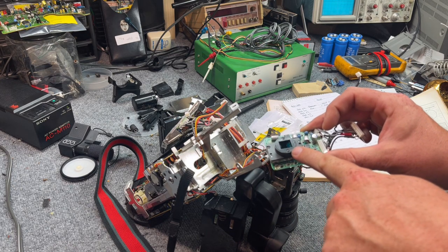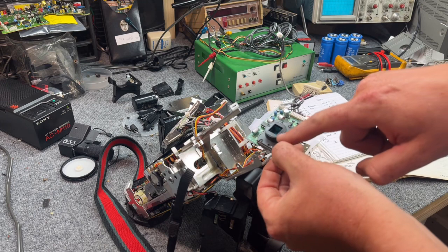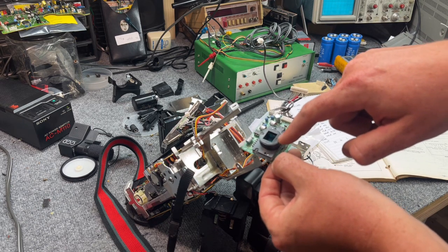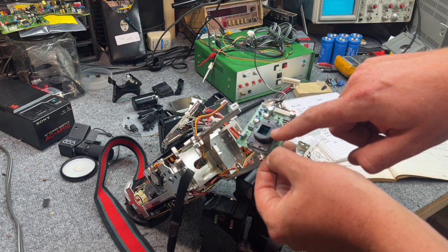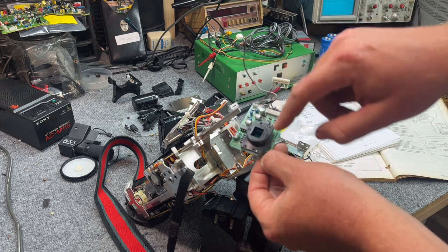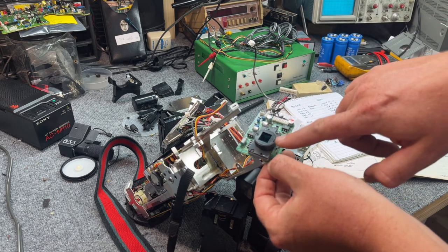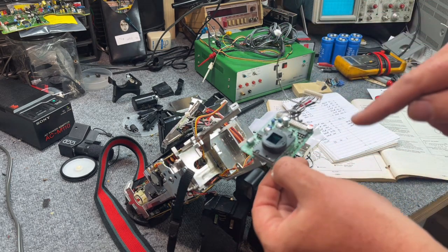What's happening is this is the infrared filter, and the optical cement that holds the few layers of this assembly together is starting to fail. I believe it's moisture-related because they seem to get worse with temperature changes — the lens fogs up, and that's when this either starts or goes rampant. You get black spots in the recorded image. This camera only shows it on one side so far, so my test recordings don't show a whole lot of fog yet.